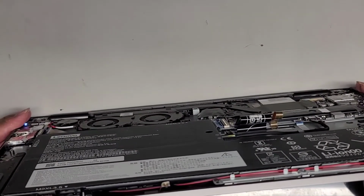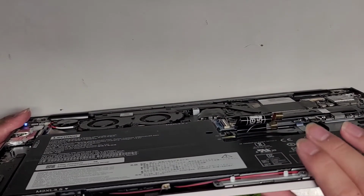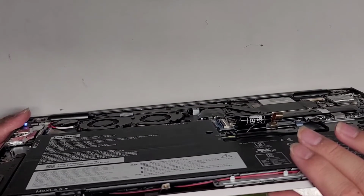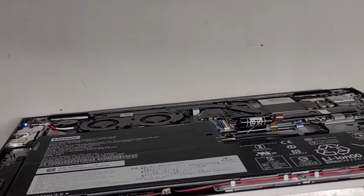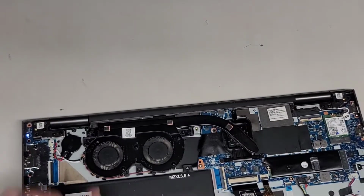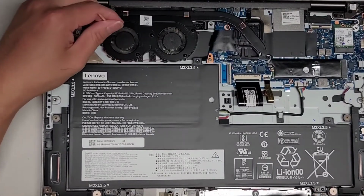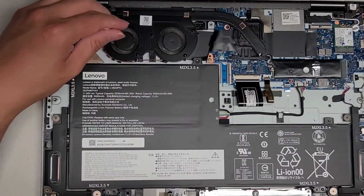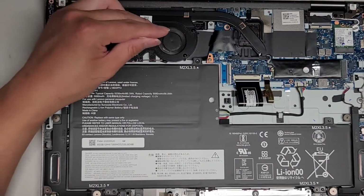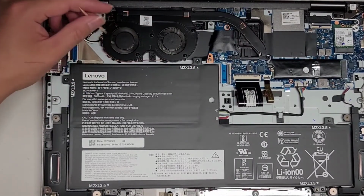Okay. Let it start up all the way. But here you can hear the fan is trying to spin around and it's making that screechy sound. Alright, so let's just shut this down. I don't know why it turned itself back on. It was shut down, so I need to make sure it's completely off. So here you can see this fan is terrible. I don't know why it's doing that. It was pretty dusty, but I don't think that's what's making it spin like that. So it's most likely the grease is bad in here. Okay, here you can see how nice this fan spins, but then this fan's kind of gunky.